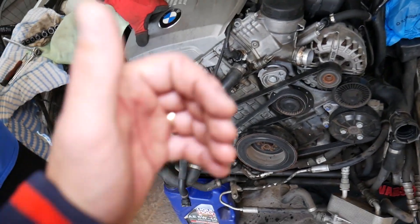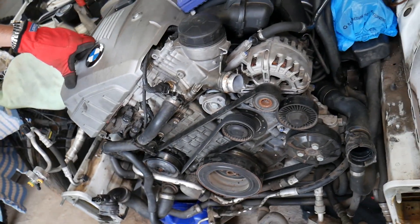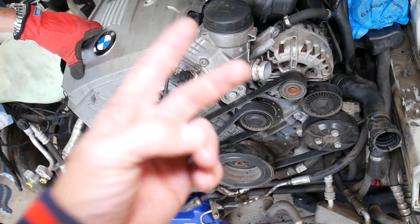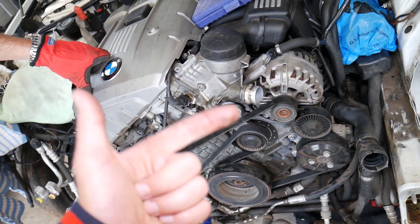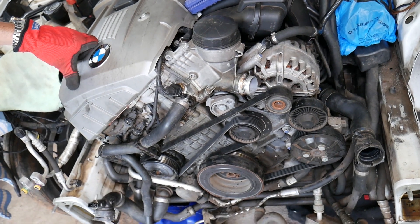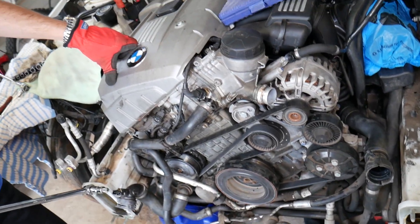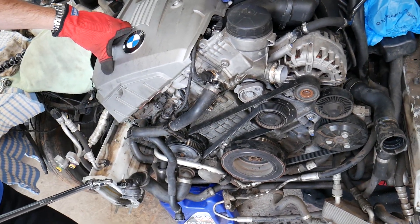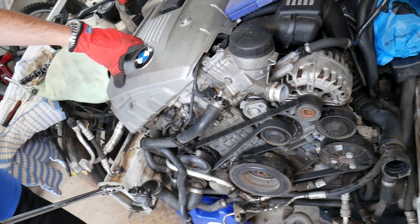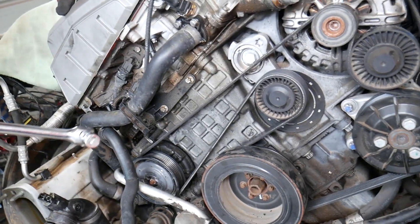When you have your car together with the radiator fan, make sure you disconnect the car battery before you start on the belt, because if that fan activates for some reason it can take your hands off. It also really matters which battery terminal you disconnect first — positive or negative — and if you don't do it correctly you can cause damage to the electrical system and the modules. Check out the link in the description below that explains the correct way to do that.